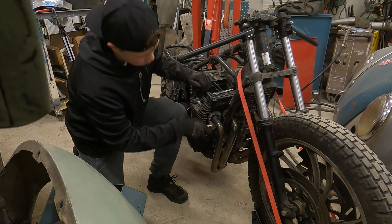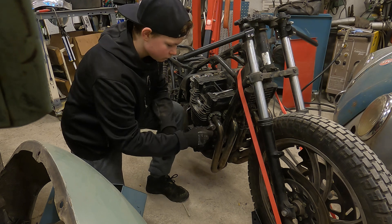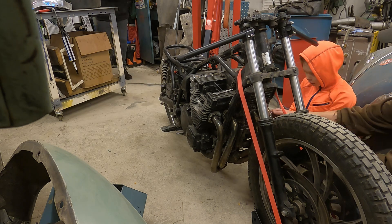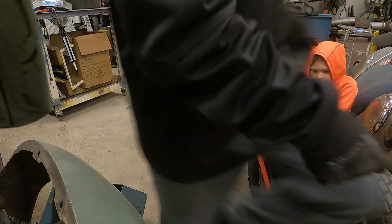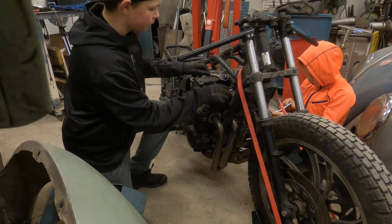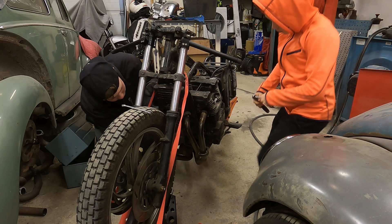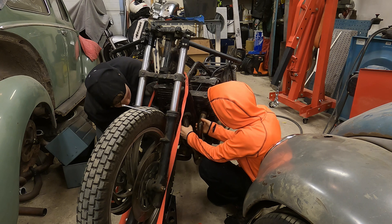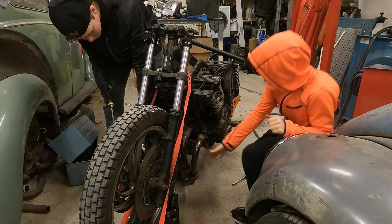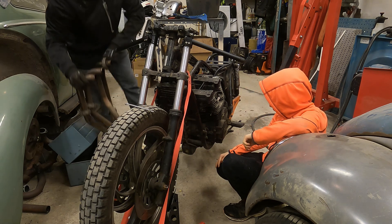Hello, all loyal subscribers and welcome to my channel. Today we return to the 1982 Yamaha XJ750 Seca project. After a long time, this project is meant to be done with my children while teaching them — and of course learning myself. Last time we worked with my oldest son, and today all children are on stage. In this episode we remove the exhaust manifold, carburetors, valve cover, camshafts, and cylinder head. The main reason for removing the cylinder head is the bad thread of the spark plug on cylinder number two. The spark plug issue was probably one of the many reasons for the poor engine running, as you can hear in episode one. I'll try to walk you through what we do and how, so that you can get tips for doing your own project.